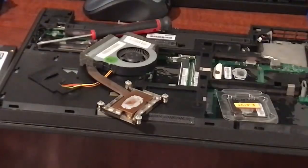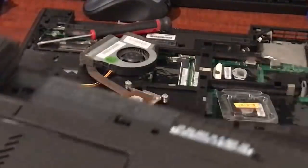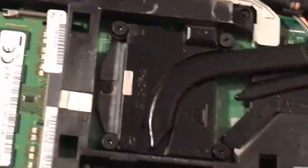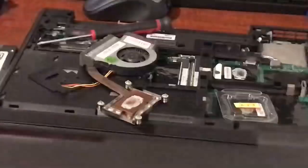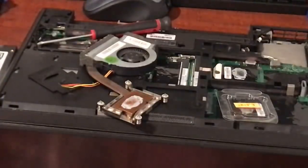If you're going to buy a T440p on eBay, what would be a good price? You can get one broken like me — this was $50 broken — and upgrade it to whatever you want. I lucked out with another T440p that has the NVIDIA GT 730M graphics, which is a pretty significant bump over the Intel HD 4600. If you get one fully working, it'll probably be somewhere between $150 and $200. The higher-end configurations with a quad-core i7, 1080p IPS display, and 16GB of RAM will be more.